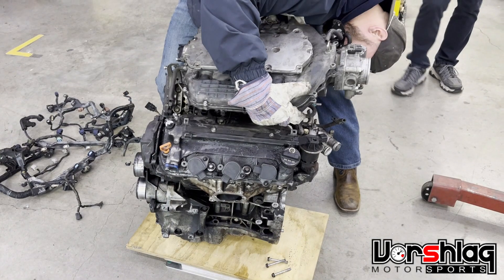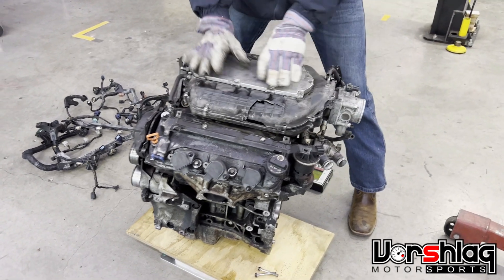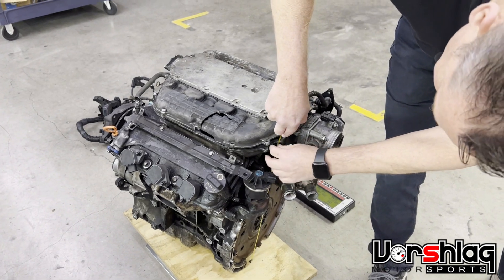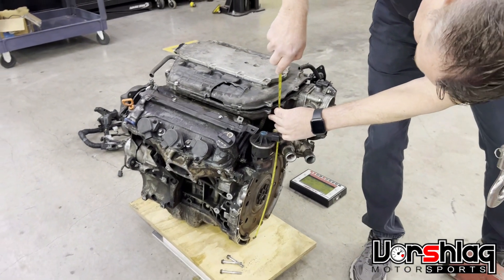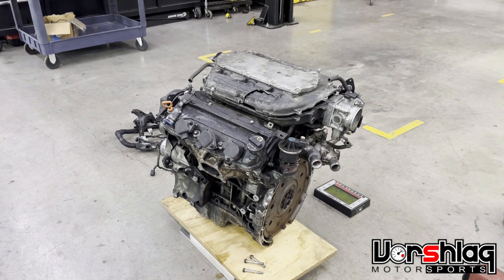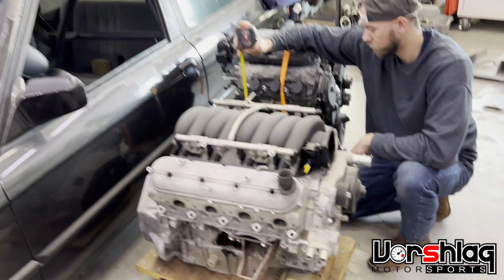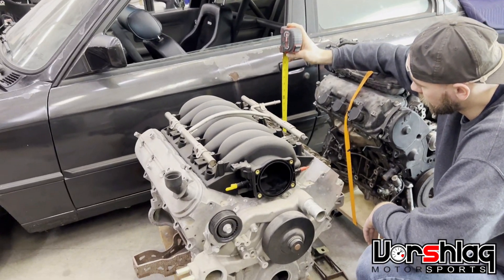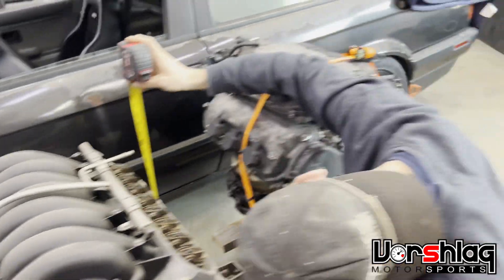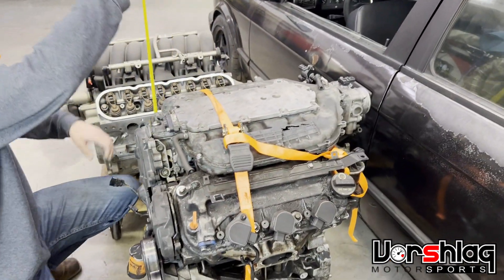Christian's going to drop that on. These are transverse-mounted front-wheel-drive setups only, so putting this in a rear-drive car is a challenge. With the plenum on, the total height is about 28 inches — that's doable. It ticks up to 299 pounds, meaning the plenum with the throttle body is about 14 pounds. For comparison, a typical LS1 with an LS3 manifold is about 26 inches tall.